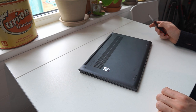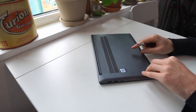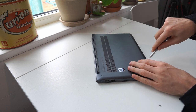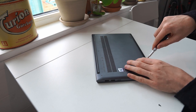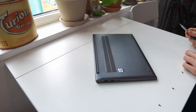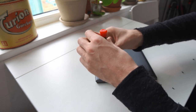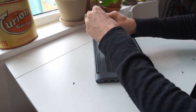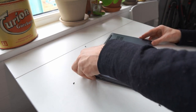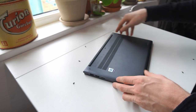Let's unscrew all of those and see how it looks on the inside. I'm using Torx T5 to get into the Lenovo Yoga Slim 7. When I'm doing upgrades like this I'm usually very careful to place the screws in the way that I took them out, so that if there are longer screws in the back I don't mix them up when putting the cover back on. Getting into the Yoga Slim 7 seems a lot easier than other laptops I've tried — the Torx T5 screws aren't very hard to remove. Let's see how easy it is to pry the lid off, because that's sometimes another challenge.